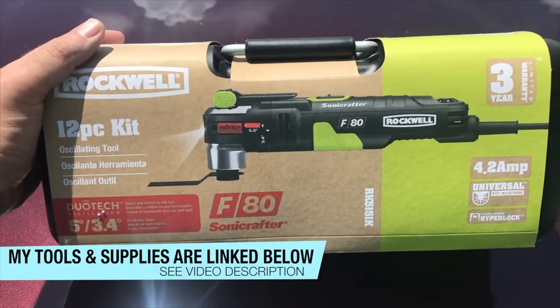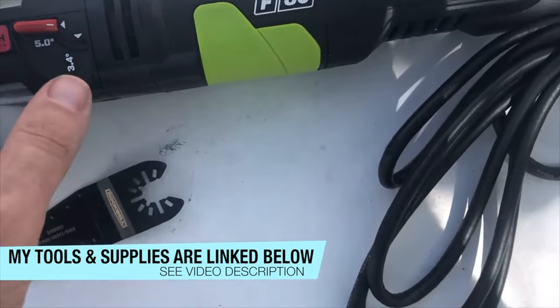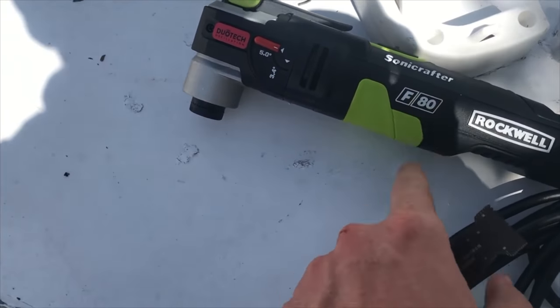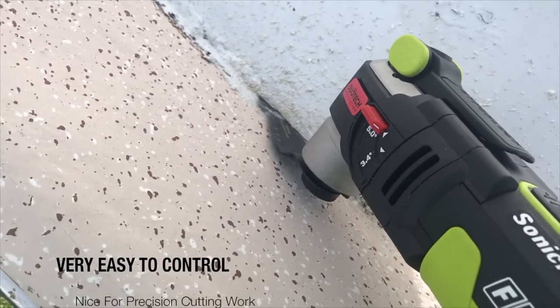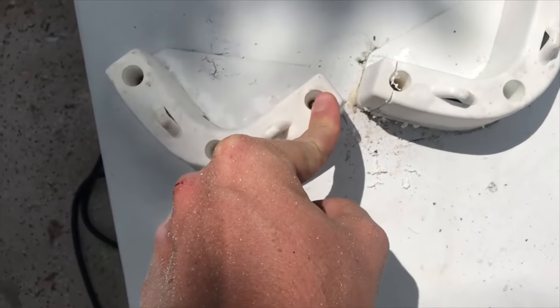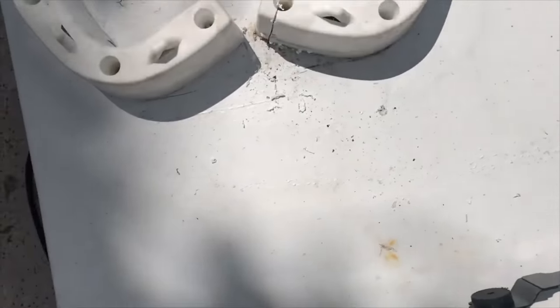I took the screws out holding the hinges for these little doors - each side had one. Some of these screws are so rusted I'm using a titanium bit and drilling out the bolt. I also picked up an oscillating tool - it has a bi-metal cutting blade, and these screws inside are so rusted and small that I can't get them out. They're holding this board to the underside support of the main hull area, so I'm just going to cut the fasteners off using the oscillating tool.